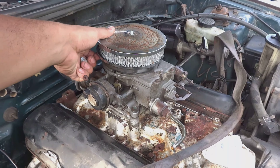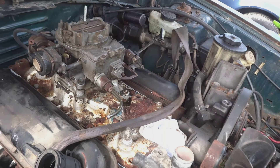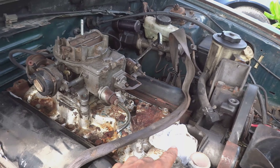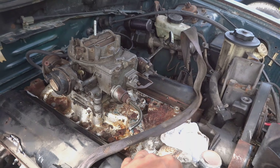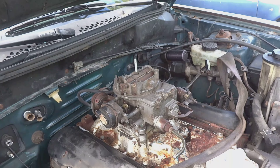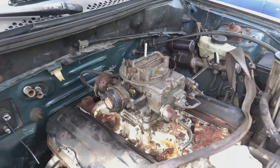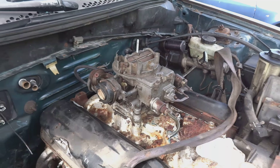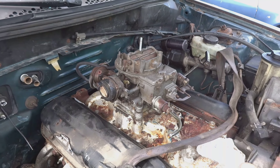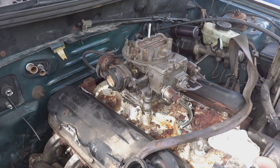Then I'll be installing the fuel pressure regulator and running fuel to the carburetor, then we're gonna do the spark. Then I'm gonna get a battery and see if that starter we put in is the right one — I believe it's the wrong one. I was told online that the starter for automatics won't work for standard shift, but we're gonna see.